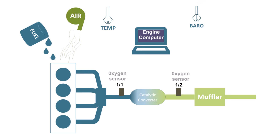As mentioned in the last video, for each catalytic converter you have in your car you're going to have an oxygen sensor in front of it and behind it — the upstream and the downstream. These two oxygen sensors are going to be sending data to your engine computer on how rich or lean the air-fuel ratio is for your exhaust coming out.